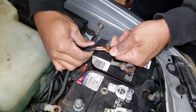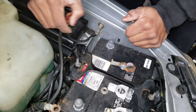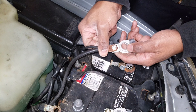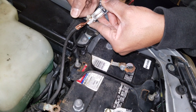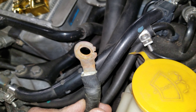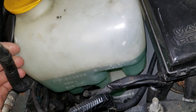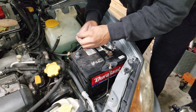That's done. I don't know if that is exactly right, but it's better than it was before. I'd like this to be a little tighter fit, but it'll work. Based on the way the old one was connecting, this will be better. This terminal, while it's not the worst, can stand a little bit of cleaning. So I'm going to clean it and this one. That's a lot better — just a quick cleaning so that it has a little bit better contact.